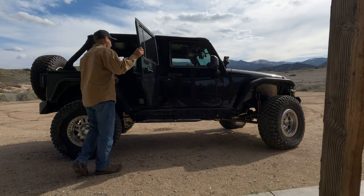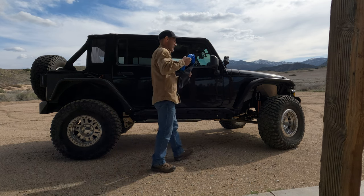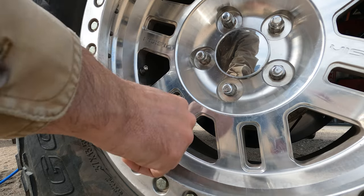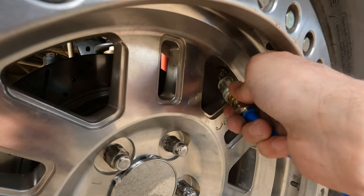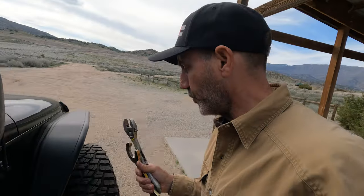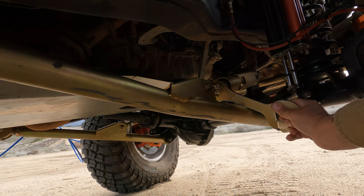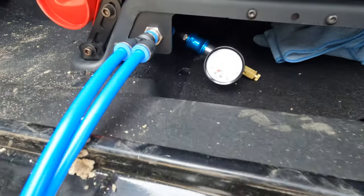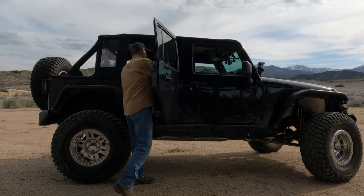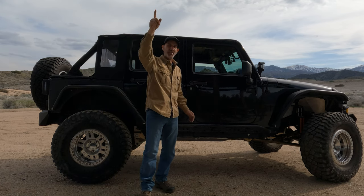Today's test went pretty damn good. This will be my first time airing up with my new four-tire system in the wild, so this is a really cool test. These little rubber caps are from Power Tank — see how fast that is, then you just put this on, turn the pressure on. I'll go ahead and lock the suspension back up. All right, 32 PSI — all systems have checked out amazingly well. I'm loving the air-up system, being able to do the suspension air-up at the same time.